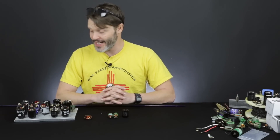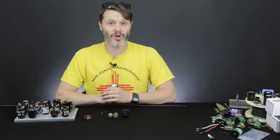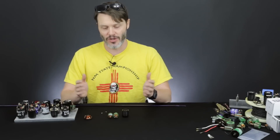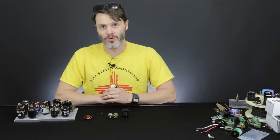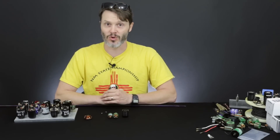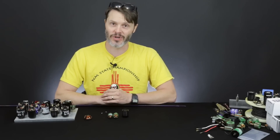Some of the other downsides: you might get addicted to putting these into your rigs because they are lighter. It's easier to tune a rig with lighter weight on the chassis. You can throw your weight down low and still have the same total weight on the ground — your tires will work the same, but you'll have a lower center of gravity on the rig. They're so smooth that you might just get used to that and say, I want this in all of my rigs.